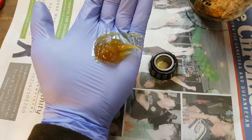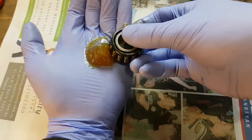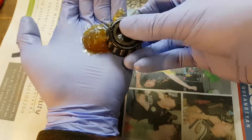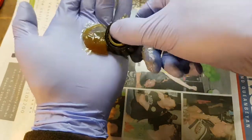To pack the bearings, just chuck a glob of grease on your hand, go around with the bearing like so and you'll see it start to come through. Hopefully you'll see the old grease come out first, which will then be slowly replaced by the new grease.